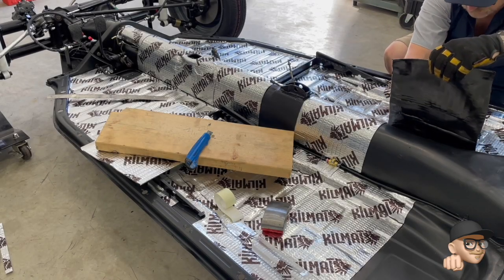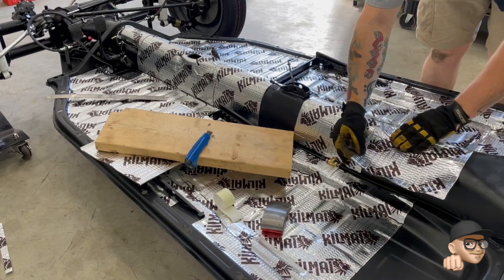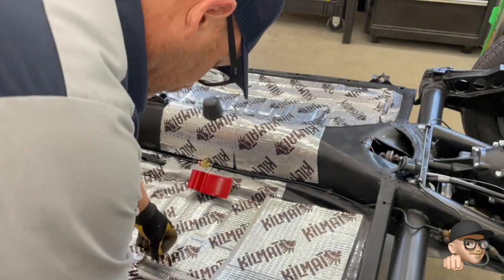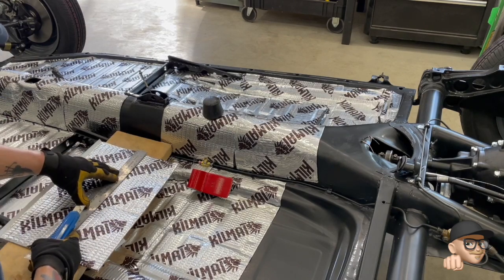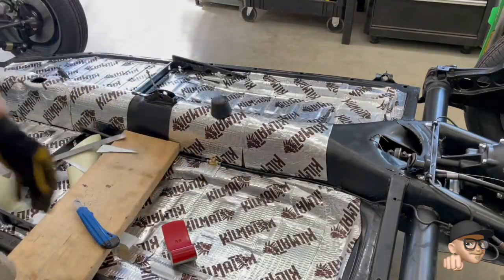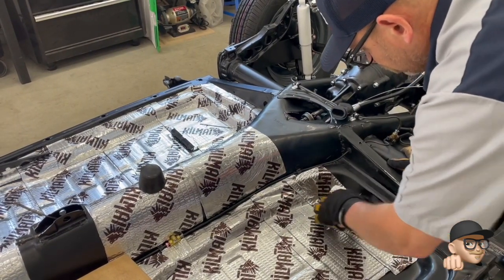Around the back of the car it gets a little tough — it is a little hard to bend. It's kind of like going for a run with wet jeans on, it's just not easy. No matter what you do it's a compound curve, pretty hard to do properly. Anyways, because I'm so awesome, I get it done. I probably put too much footage of this in here — it's actually not that interesting. That's a dolly I'm using to flatten it out. You have to push it until the little bubbles are gone; once the bubbles are gone you know it's adhered properly.